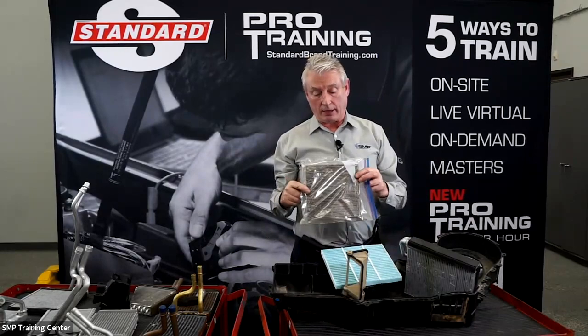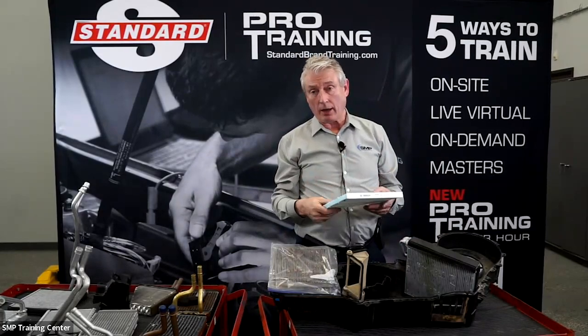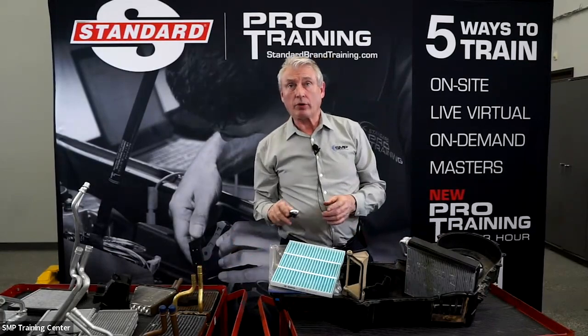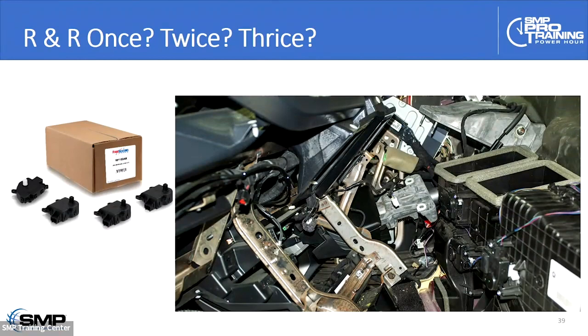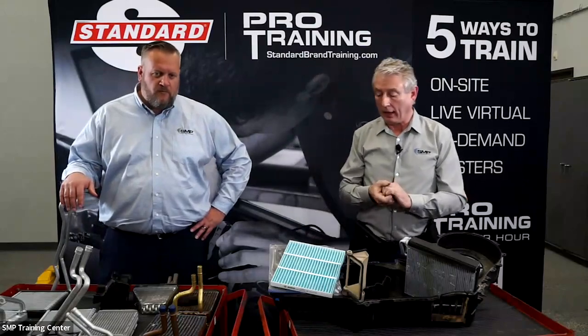Of course, the other common-sense item is to replace the cabin air filter. You've just charged the customer a significant amount for maybe a six-to-seven hour labor job — replacing the cabin air filter is the icing on the cake to give that extra bit of airflow improvement. Also on 2015 Ford F-150s, the air door recirc door tab breaks off. When this happens, it usually results in an air conditioning complaint but often also results in a poor heater quality complaint in the wintertime. Check for a recirc air door trouble code. The key takeaway: before attempting any of these jobs, ask yourself — are there other components I need to consider before replacing the heater core on this vehicle?